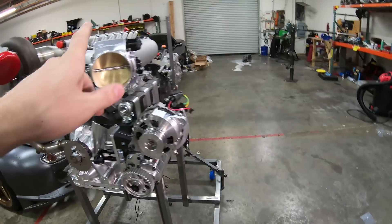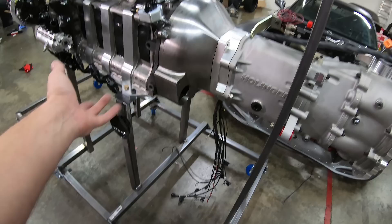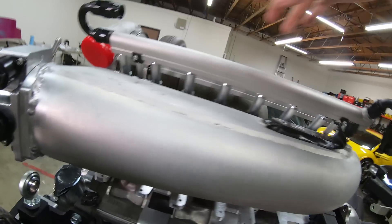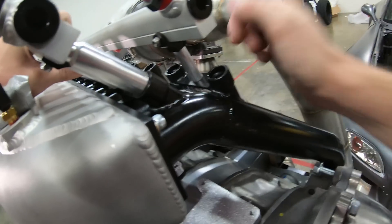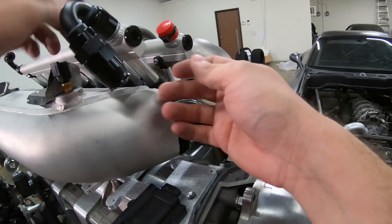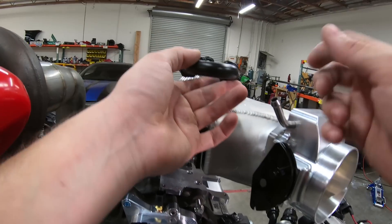It's all going on all at once. I'm doing everybody a disservice by not putting this on here. They seem a little taller than they should be — that might screw me. I might have to hone these out. They'll work, but they're a little tall because they're hitting out here. If I have time, I'm going to have somebody with a lathe pull them down a little bit. This is where Earl's slash Holley just rocks it. This is a 150-degree angle piece. I've got another one coming in here, so they're more managed. And then here's the 180-degree pieces, and that's actually working even better than I was expecting.